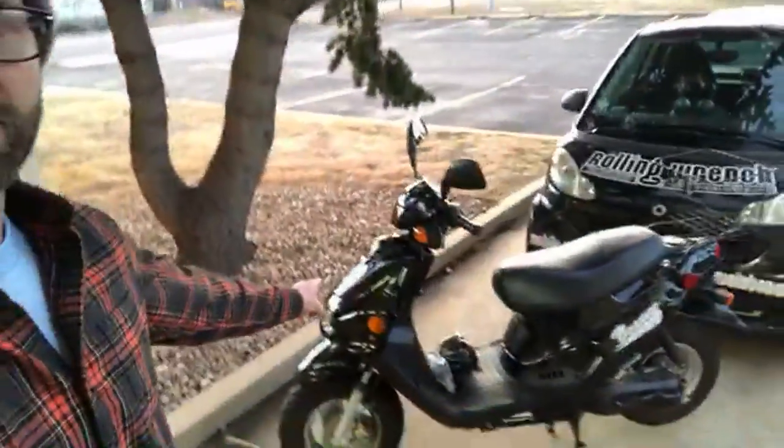Buddy 50cc two-stroke, or Eton Beamer 50cc. Those two-strokes do better on hills, and they're more peppy. Two-strokes overall are going to have a lot more power. They have about twice the power of a four-stroke. They just don't last as long because they wear out quicker. But they're cheap to fix, easy to fix.